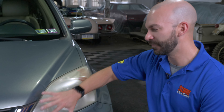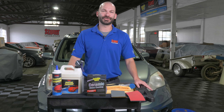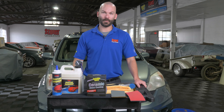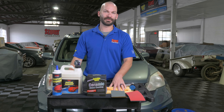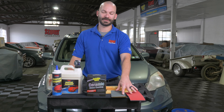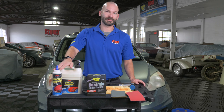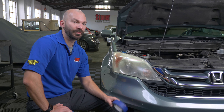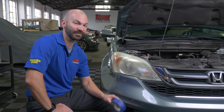What we're gonna do is physically remove this outside part of the plastic to let the under layer that's still clear and virgin shine through. We're gonna clarify headlights using two different methods today. Depending on the method you choose, you're gonna use some of the following raw materials: water, a polisher, microfiber towels, painters tape, different cuts of sandpaper, some kind of sealant, and a cutting or clear coat compound. We'll show two different ways of doing this, but they both start with the same steps.